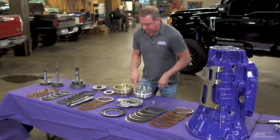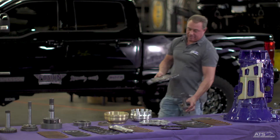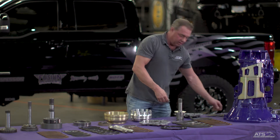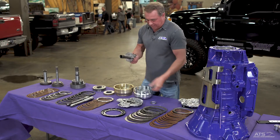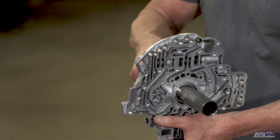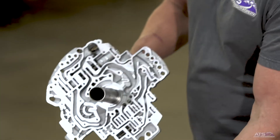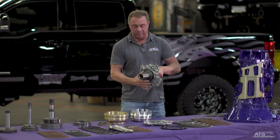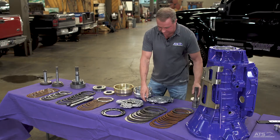We've also addressed the stator, which is another big deal. The torque converter we build has such a high torque multiplication stator that it will literally twist the stator out of the stator support. So we've redesigned how the stator goes into the pump — we use hardened bolts and a pin support that holds the stator as part of the pump assembly, so the stator doesn't twist out and create hydraulic loss or a broken stator.